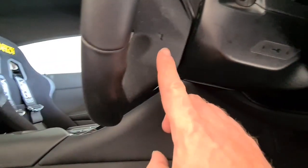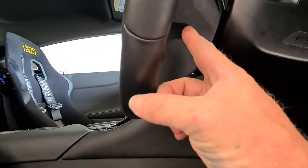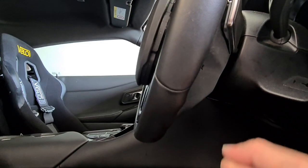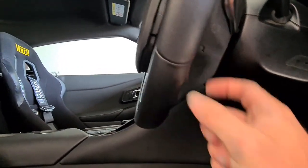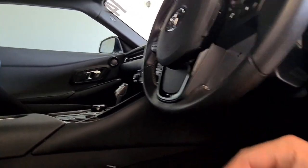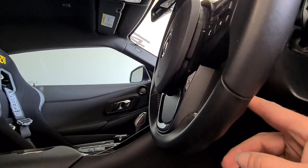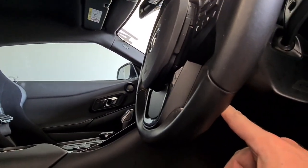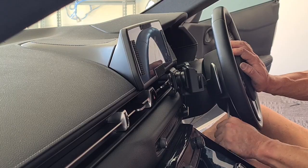Next, I've already done one side. I'm going to show you - we need to stick a screwdriver in this side here to puncture a hole in the side of the steering wheel just so we can release the airbag. I'm going to set the camera up on the window on the other side of the car so you guys can see exactly how I do that.